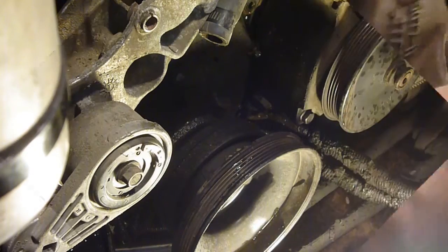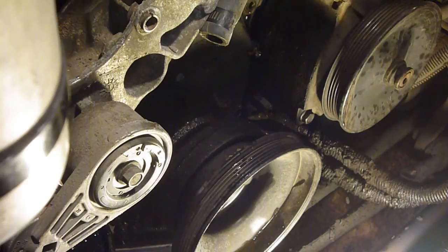First of all, once you get everything out, you want to make sure you check all the parts you bought to the parts that you're taking off. Make sure they're identical, because I've had cars that the same year, make, and model of car had 2 different types of alternators on it and 2 different types of starters on it, depending on what time of the month they decided to build and what time of the year they built it. So you got to be careful. You can't just assume a part's going to fit. So keep all your parts first of all. Don't throw them away. Second of all, most of them you're going to have to turn in for a core charge anyway. And third, if you don't turn them in for a core charge for some reason, they can be recycled.